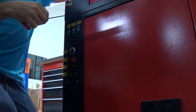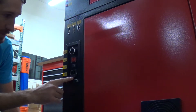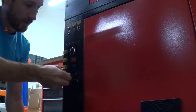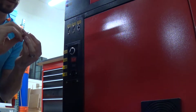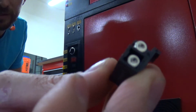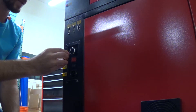Pop out these four screws. I'll also show you right here — here's my power plug. There's a little fuse right below it. All you do is stick your nail in there and slide that out. Your fuse is the one that's not inside the box. You can check that to make sure your fuse isn't burnt out. You can also store an extra one in there just in case. As long as that's good, you can slide it back in.